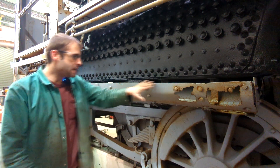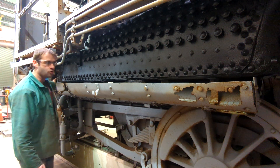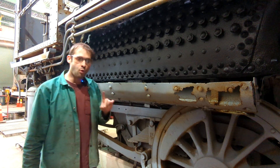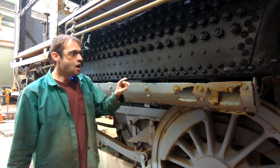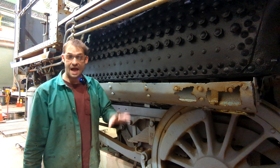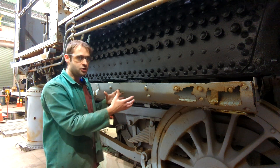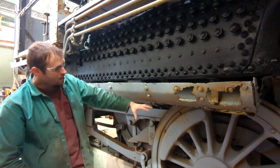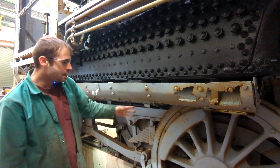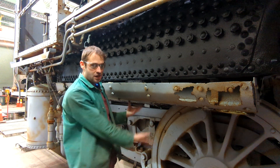This pan goes from here and runs about seven or eight feet all the way down, so when I drop it I need to make sure I have something underneath to catch it because it's going to be heavy. Here's the top tip for the episode: if you ever remove things like this, always leave a couple of easy-to-reach nuts that you can remove last. Get everything else set up and removed except those two pieces of hardware, then drop it. If you leave the hardest nut for last and you have to go underneath with bracing in place, you're putting yourself in danger.